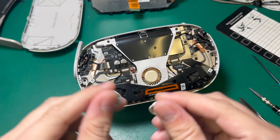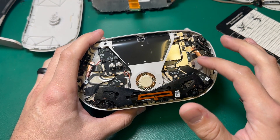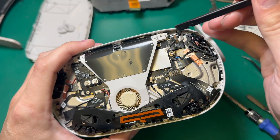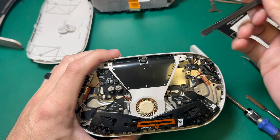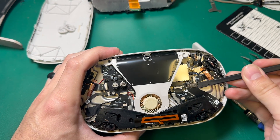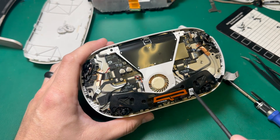Go ahead and remove these camera rings — we won't need them. Then I'm going to undo this retainer, which holds in the WiFi cable, the battery cable, and the charge port. I can do almost all of this with my Phillips screwdriver. The battery cable is a little sensitive, so I'm going to use my plastic pry tool to pop that open. Same with the charge port. Now I can move both of these out of the way and take off the Bluetooth antenna.